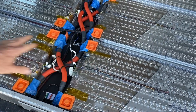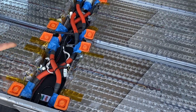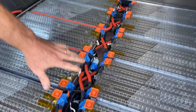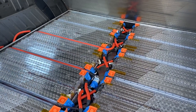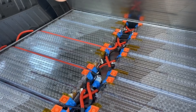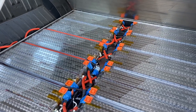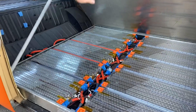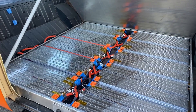What you have here are two Tesla modules in parallel — that would be 2P, P for parallel. Then you have four more of those pairs for a total of five, and those are in series. So those connect together like railroad cars, one after the next. So you have 2P 5S. That's the configuration of the pack.